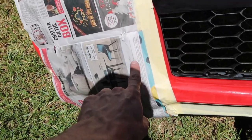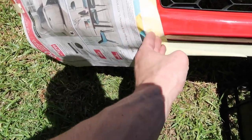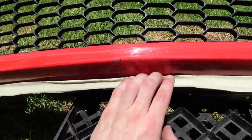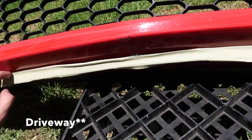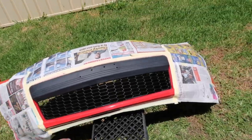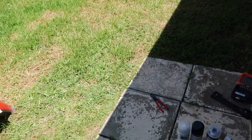I'm pretty much going to be holding this edge line here and then just coming down on the angle — so it's not exactly straight, just to give it a more aggressive look. The tape is not sticking on this edge because it's been chewed up by the garage, but you're not really going to see this low anyway so I'm not too fussed. I'll give it a quick sand, we've got it all masked up, then I'll do three coats of primer, three coats of black, and then the clear coat. I'll set the camera down and let's get it going.